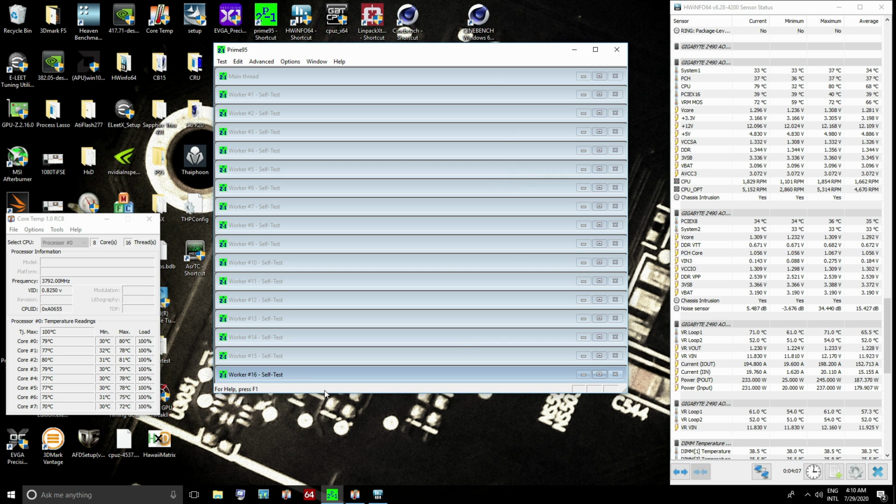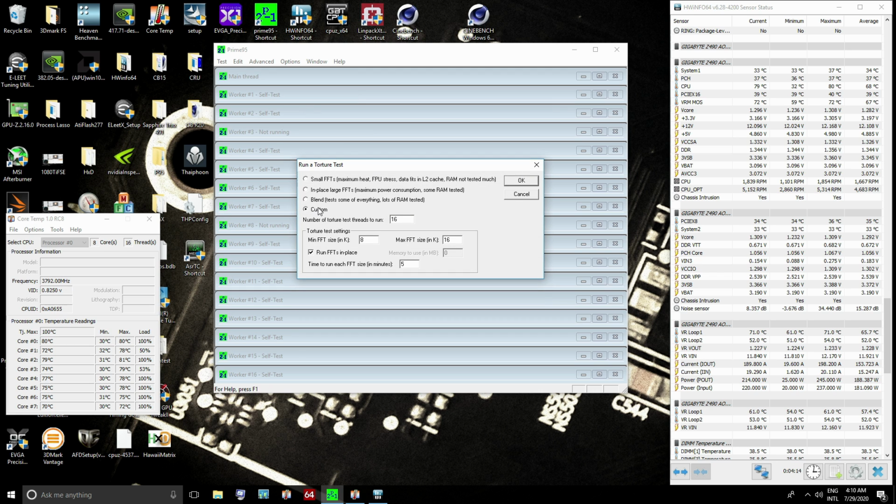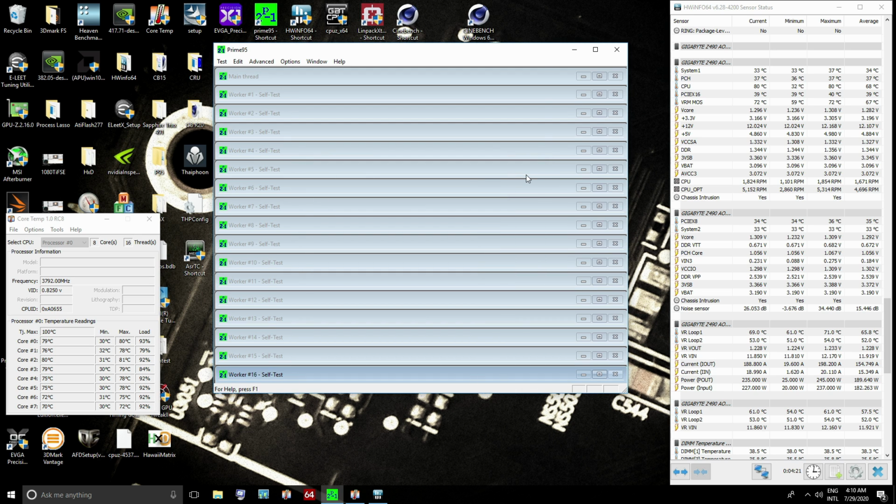Okay, let's start moving the mouse again, please. No, we just lose a bunch of threads. This is super annoying. This motherboard's too good. There are other motherboards where this would pretty consistently just crash outright, but this motherboard's pretty good about just not completely dying, which for the purposes of this demonstration is actually really annoying. But the other issue is, there's a lot of motherboards where you can't get access to this sensor. And we just lost core 3 again.